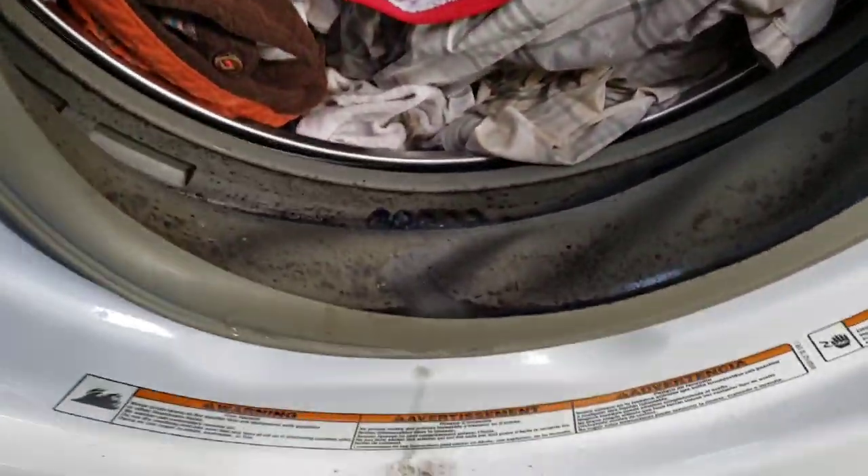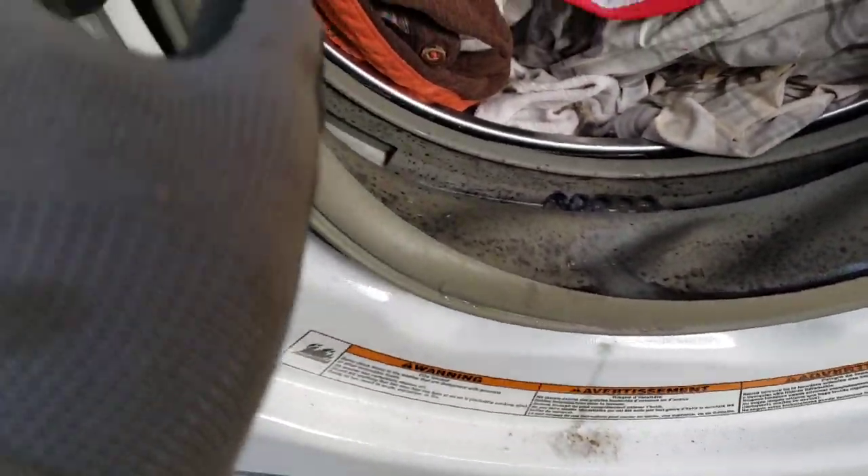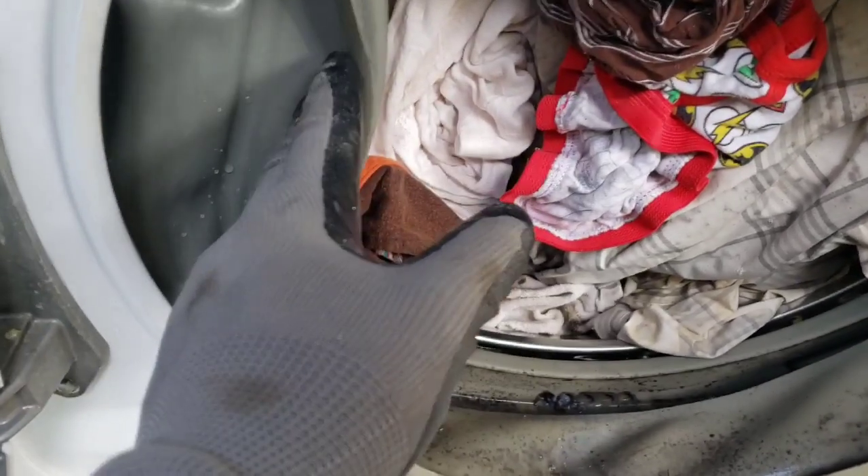So that's what it is. See, now you can see the hole — and you can see the silver part, that's the inner tub. So all I'm going to do is pop that hose back in the hole. Basically no tools are required, I guess — well, you need a screwdriver to pop this, take the ring off, and take this out. Any questions, feel free to message me, and don't forget to subscribe and like for more useful tips.